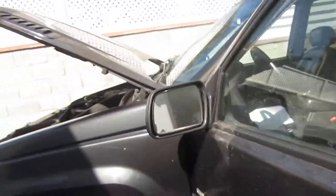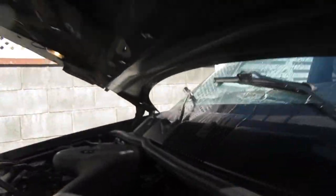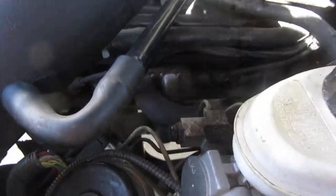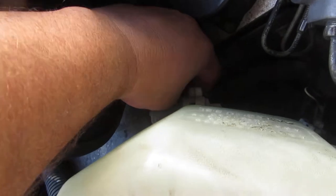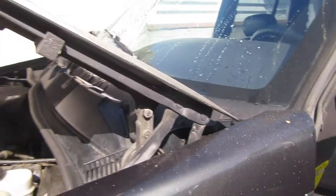But my other problem is my reservoir is going low and it's still squirting. Crazy, so I drive home like that with just the squirters going, but of course I run out of juice before I get home. So just to make things manageable until I get parked, I come to the bottom of the reservoir and pull this connector here — that's where it's connected right there — and now the squirter has stopped. So that's what's going on.